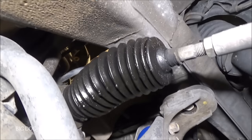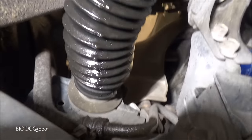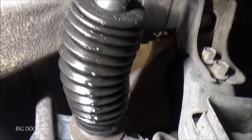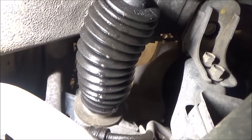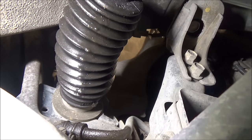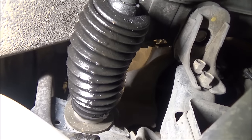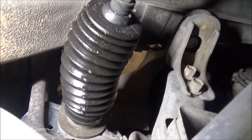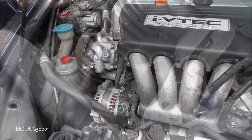Looking at the passenger side — Houston, we have a problem. We found the leak right there. That looks like the seal where the inner tie rod goes into the rack. Pretty good leak too — pretty common on these. If you own a Honda for any length of time, you're probably going to have a seal leaking right there. There are kits you can buy to repair them, but I don't do that — we just replace the whole rack. I prefer to use a Honda rack because aftermarket ones are garbage, and if you're going to do all that work you don't want to have to do it again. This is an expensive repair.